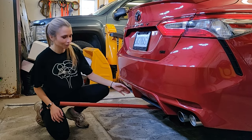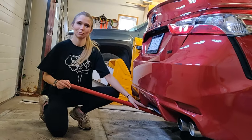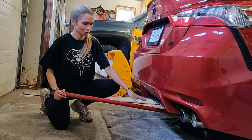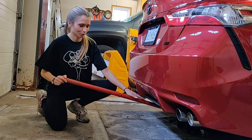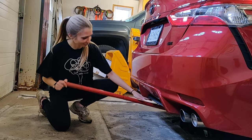If you look down the center of the vehicle at the back, there's a jacking point just below the rear subframe. Be careful when you're jacking because you are very low to the vehicle and you don't want to smack the back bumper. So put your hand there just to make sure you're not going to hit it, and begin jacking.